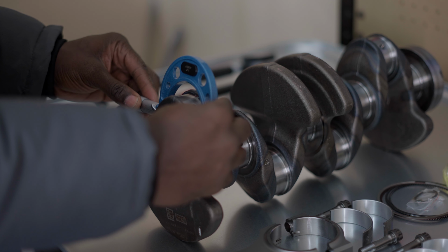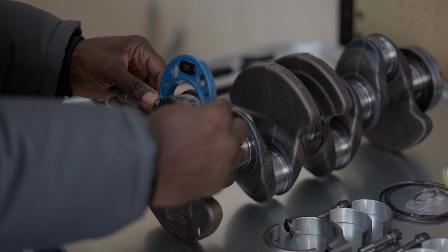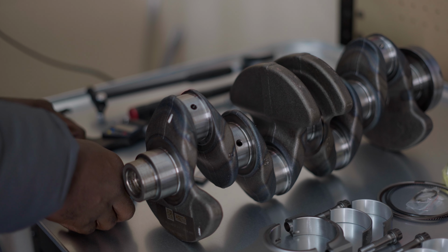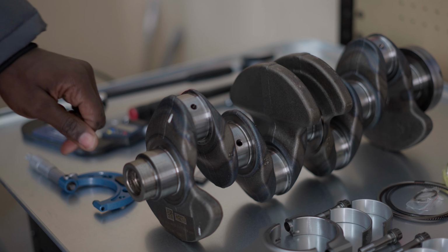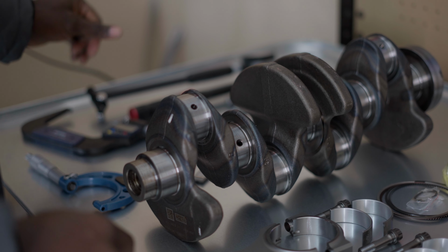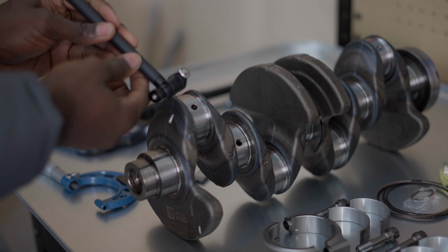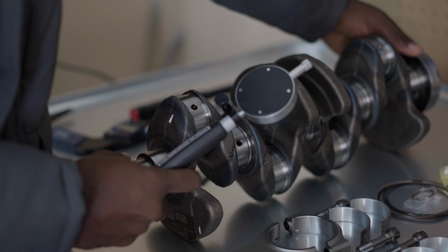And I also noticed the crankshaft that came with this block has a thinner diameter compared to the other crankshaft. I tried to use the other crankshaft, and I didn't like the clearance. It was too tight. I needed smaller bearings, and that's just too much thinking. So I decided to keep this bearing and go with a thicker oil, but more on that later in this episode. So I went ahead and rebuilt the motor.